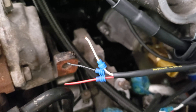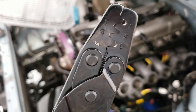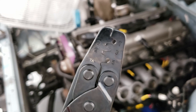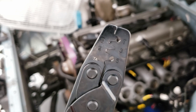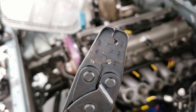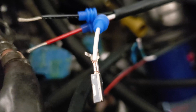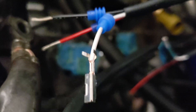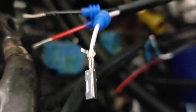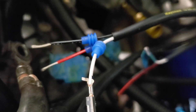Weather stripping on, now time to strip the wire. Strip it and add a crimp. On the crimpers, positions one and five are round - that's for the weather sealing. Positions two, three, and four are for the crimps. I've been using number two, the smallest one, on every crimp and it's been working awesome. Got the first one crimped - curves around on both sides, meets in the middle, a little V. Nice connection. Do a pull test. Next step is to crimp the weather sealer.